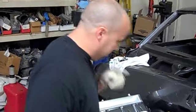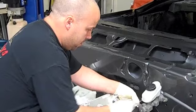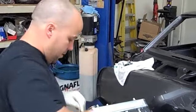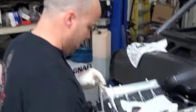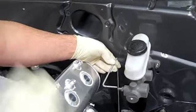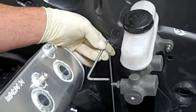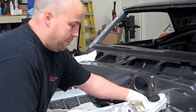Now that the first bend is done, one easy way to figure out where it needs to be bent next is just take the bend, put it back on the firewall, and go ahead and mark where the fitting is. The first upper is done — it's going to line up right with the fitting and give enough room to flare. On the second one, flare the tube first and then bend it so you can get it in tighter. That's a quick, simple way to bend up lines, make them look clean, and get the job done.